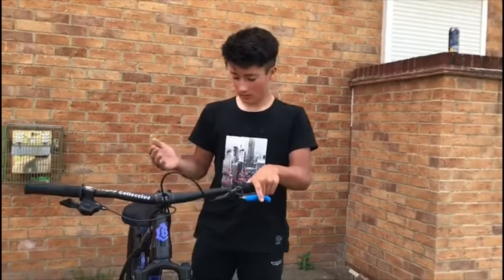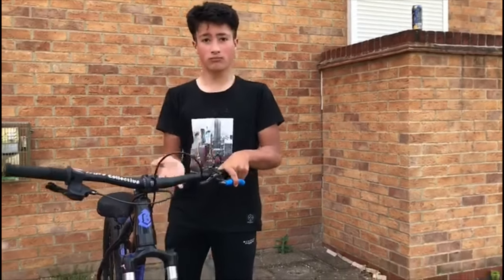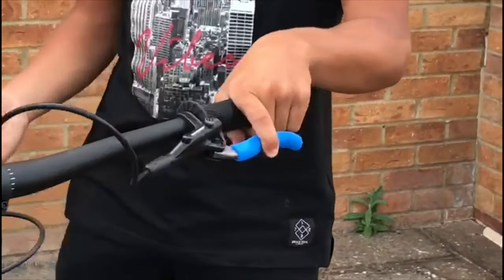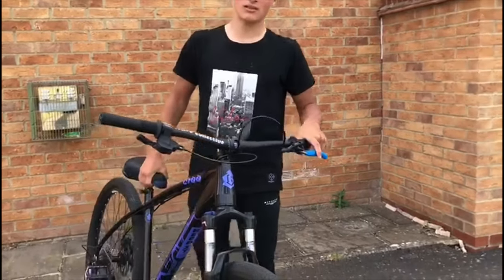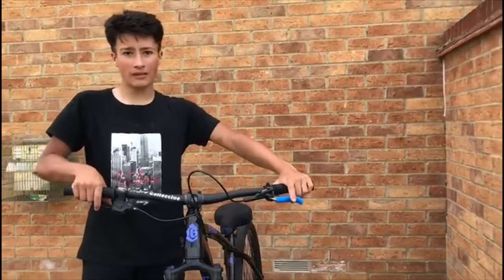Good brakes to get would be hydraulic brakes. Mechanical brakes wear out quicker, whereas hydraulic brakes use mineral oil which makes them last longer and they're sharper, which is good for learners. Good hydraulic brake brands include Shimano XTs, SLX, Saints, Hope, and others. Hope brakes are a little bit sharp though. Make sure you get a good reliable brake because you don't want to fall back — your brake is what you use to keep your wheel up. If you've got an unreliable brake that cuts out, this is what could happen to you.